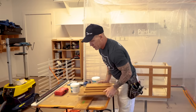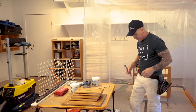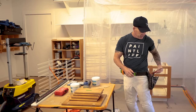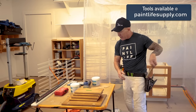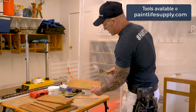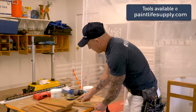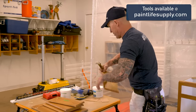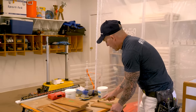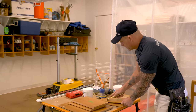So I'm going to get ready to start applying some Aquacoat. Some tools. Definitely, absolutely love the two-edge knife. Use it for different things. When it comes to removing adhesive, you could sand it off or you can scrape it off. I'm going to want to scrape everywhere where these hinge holes are, and then I'm going to scrape off the adhesive that was left behind from our bumpers.